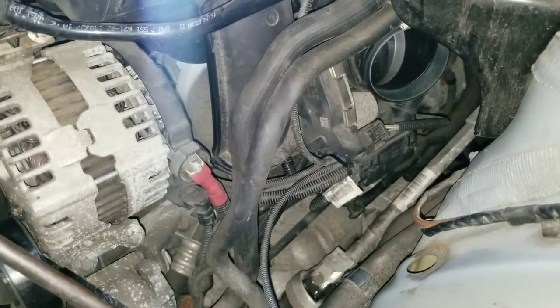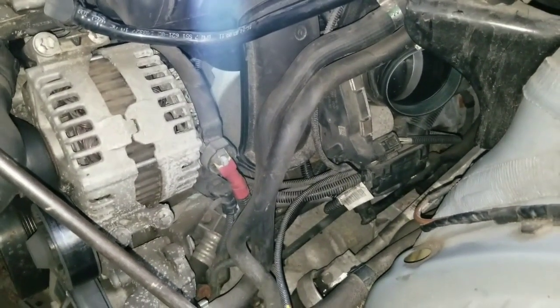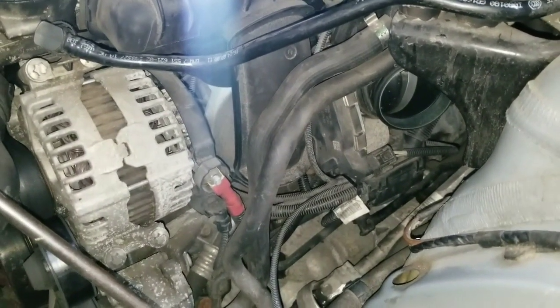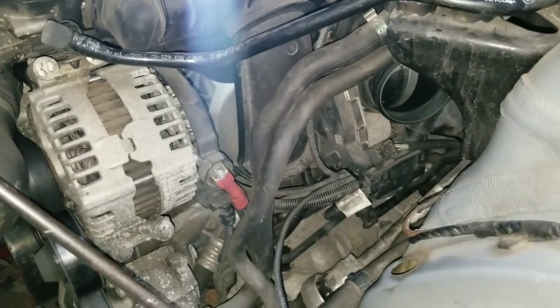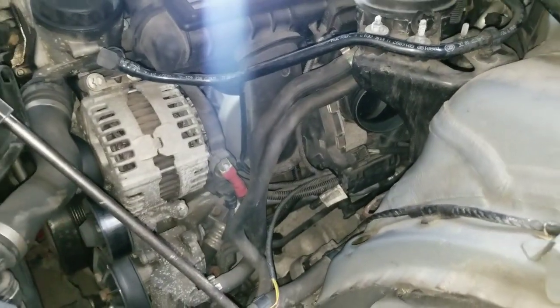Went ahead and re-secured the hose, cleared the codes, and I believe we have a fix. So if you have a 2A16 trouble code — fuel tank ventilation system, purge air system, minor leak — you probably have that issue there. Thanks for watching. This was George, Melnix Automotive.